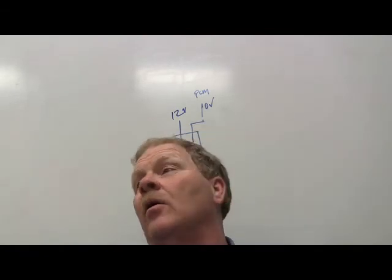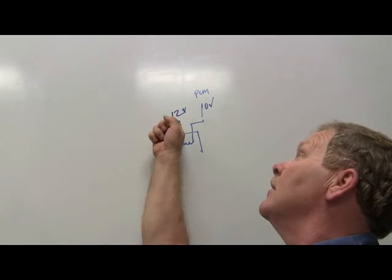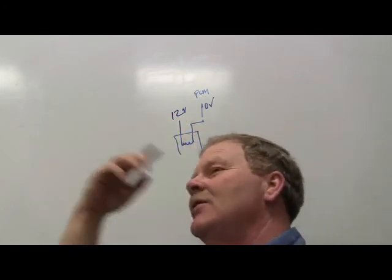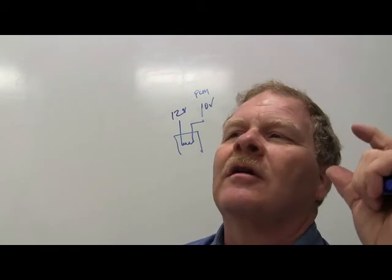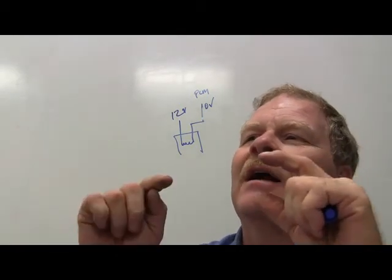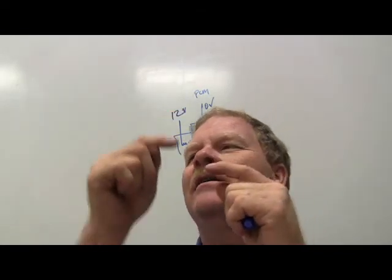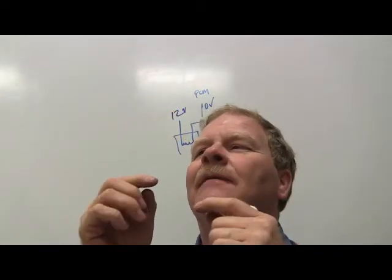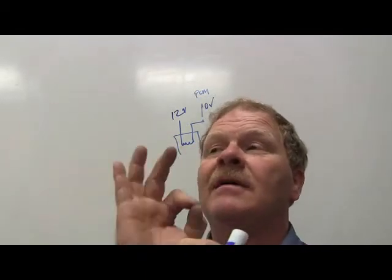If it doesn't come on, what does that mean? That means that you've got a problem either on the power or the ground side of this. Then you got to identify which is which. If you're smart, you'll run it through a little project box and you'll make a little breakout thing. You'll have 2 little banana plugs, one of them teed into the hot side and one of them teed to the ground side. And then you can take your test light or your logic probe and see what you've got missing.